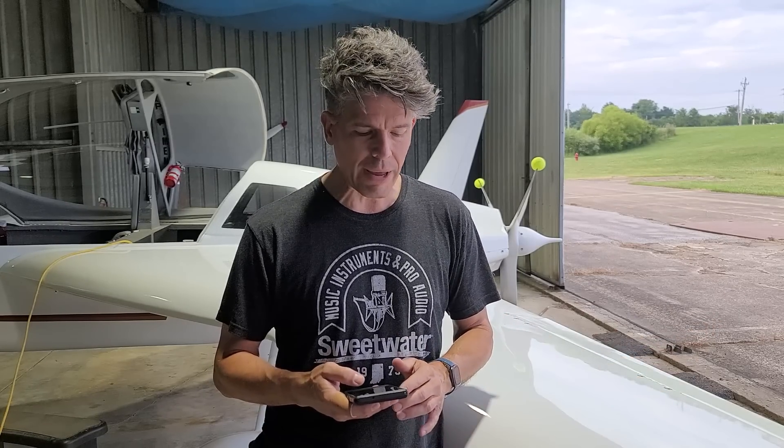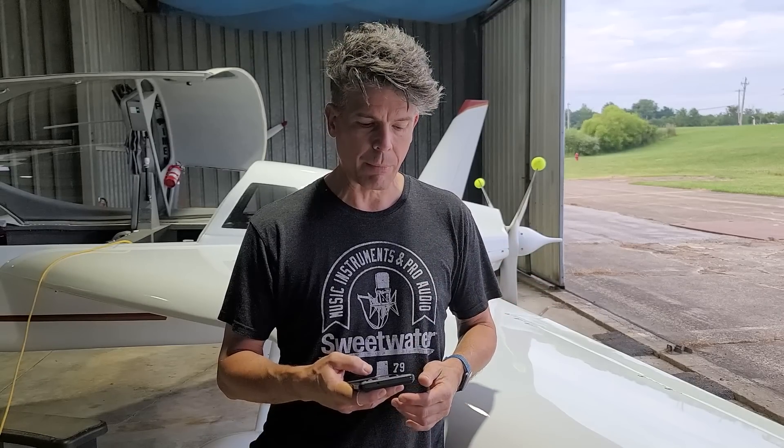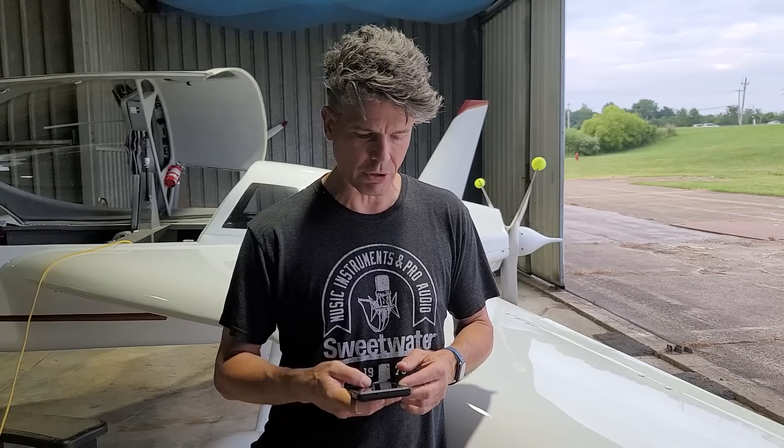For the full power climb with the manifold pressure sensor on, I got 2330 RPM and 57 degrees before top dead center — just nuts, way too advanced. My EGT average was 1200 degrees Fahrenheit and my CHTs were skyrocketing. I turned off the manifold pressure sensor and went up to 2370 RPM — timing came back down to 40 before top dead center, which is close to where I'd want it. The EGT went up by 30 degrees, but more importantly the CHTs started coming down. With it on I was seeing 410 and still going up. After I turned it off, they stabilized at an average of about 375 during the climb. At 57 degrees, it's almost the point of causing engine damage.